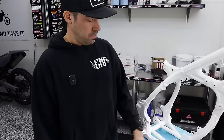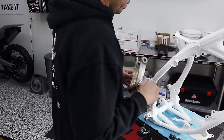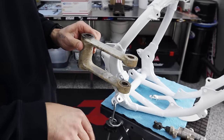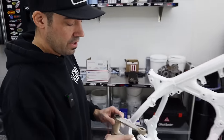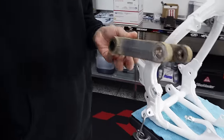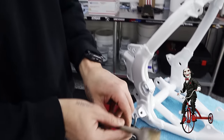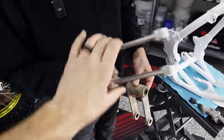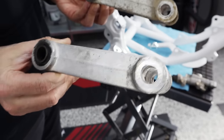So what we did discover from the teardown — there were some scars, it was sad, and we can't reuse that anymore. I wouldn't trust the integrity of it. What the hell is that glob of aluminum on the back? The shock bolt backed out at one point, and as it was going through its stroke it just kept wearing into the link arm, eventually came to a stop, and that's where they discovered this. It had been repaired — remember the movie Saw? It was definitely a saw moment. So your shock bolts come out, you go over the bars. We'll show you guys what we copped on eBay for a couple of bucks — it looks damn new, it was off of a '96, no weld repair.